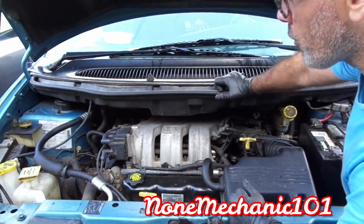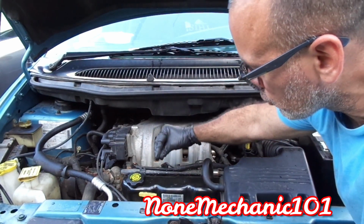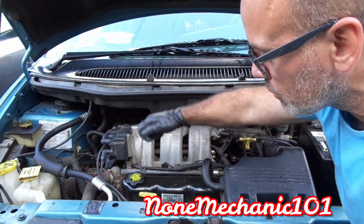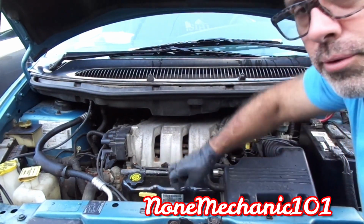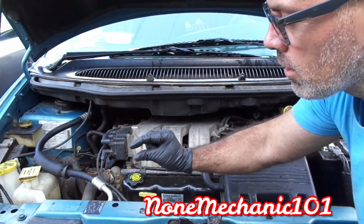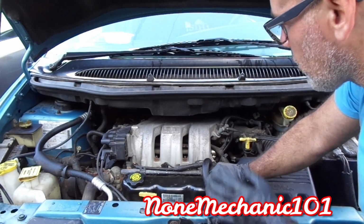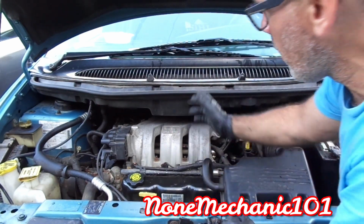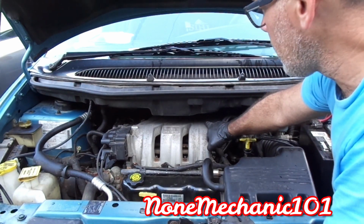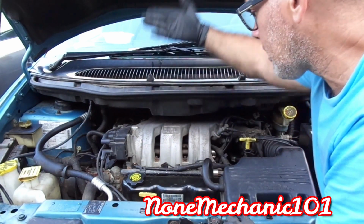The mirror worked perfectly. Just make sure that when you put it in, the spark plug goes straight in, and you can actually look at it with the mirror to see if you're in the hole. Because if you're not in the hole, you think you're getting it in the hole, and what happens is you crush the spark plug gap and you'll have a misfire. So that's what it is. Number 5 was okay, number 3 was hard, number 1 was easy, and this is how you do it.